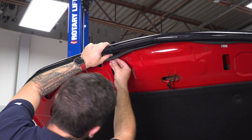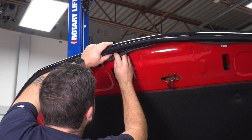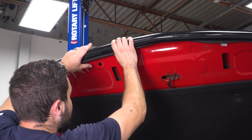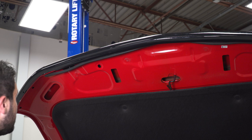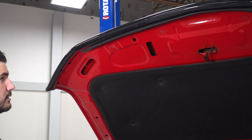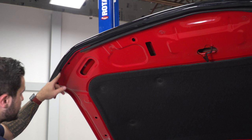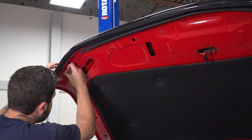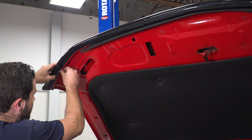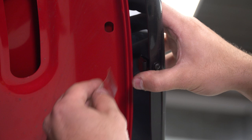Once that's in there, put the Phillips head screw through the hood liner into that fastener, then push it in to lock it in place. Repeat that for all four. You can use a Phillips head screwdriver to help lock it in. Once you knock out both sides for those hood pins, come over to the edges where the plastic clip is. Even though it's plastic, you still don't want it to make direct contact with your factory paint. Take note of where that clip lands on the hood, peel off the backing on the protective film included in the kit, stick that film onto the underside of the hood, and wrap it around the edge so it's on the outside as well. That plastic clip then goes on the protective film instead of right up against your factory paint.